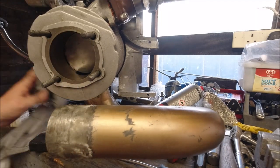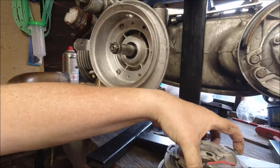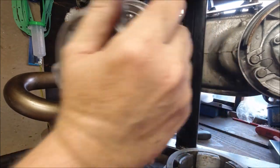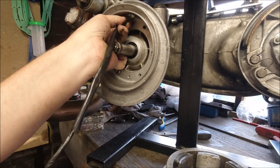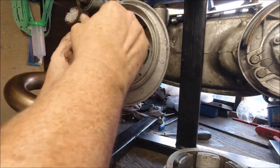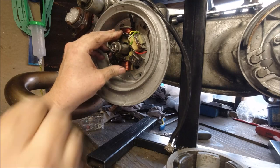Just give that a clean — never hurts to be clean. When we get the flywheel and stator plate back on, the flywheel has good magnetism on that. I just need to spray it down, clean it, and put the cables through the hole. I've taken the opportunity while cleaning the mag housing to deburr all of that. I need to make sure we don't pinch our cables so it turns freely.